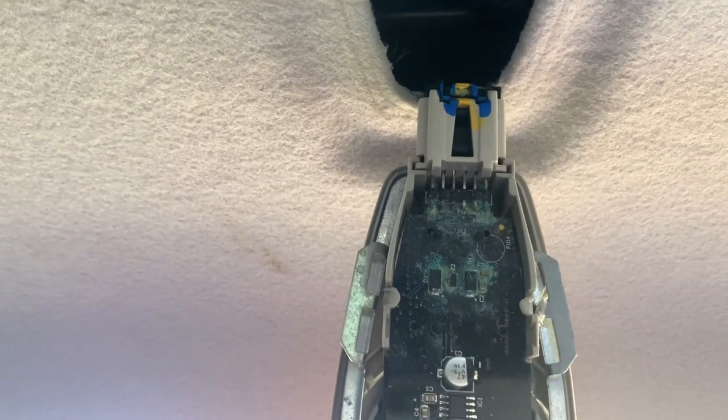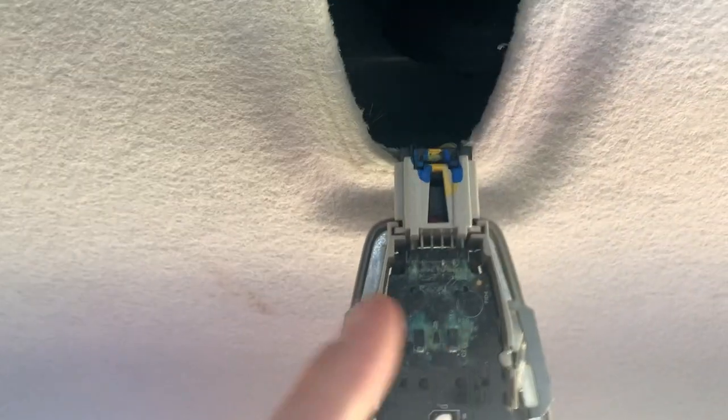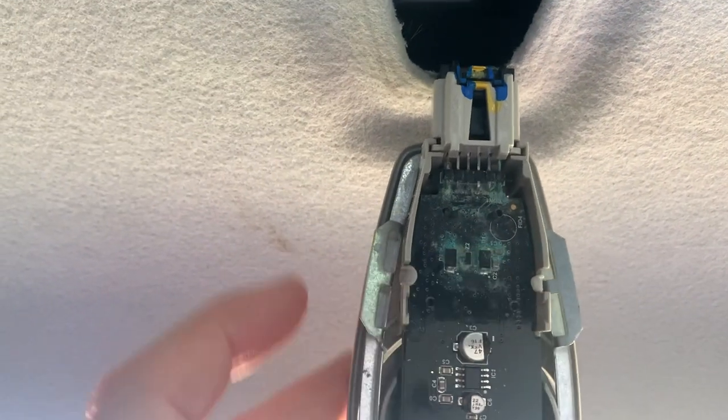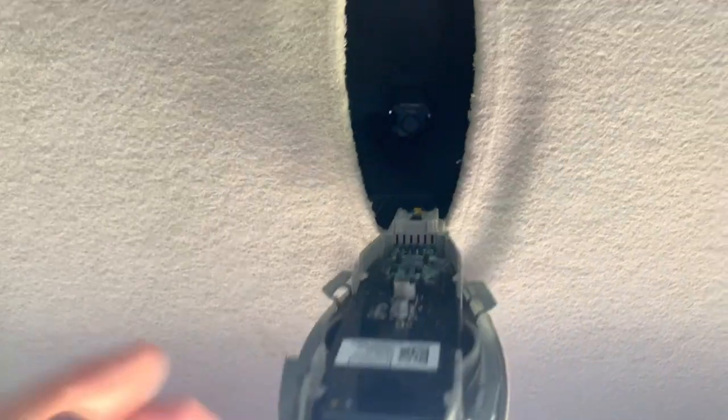Because the aerial has been broken you can see that moisture has penetrated inside and caused some build-up around the light — so that's the last thing you need. Make sure that if you do have a broken aerial you're not getting water or moisture in there, as it could potentially damage the roof lining or the light itself. Once you've got the light out, you'll see the switch for the light — just unplug that and it should come straight out.